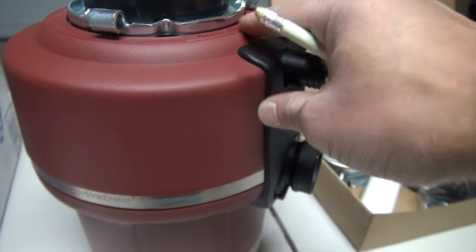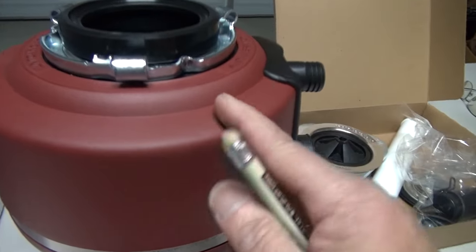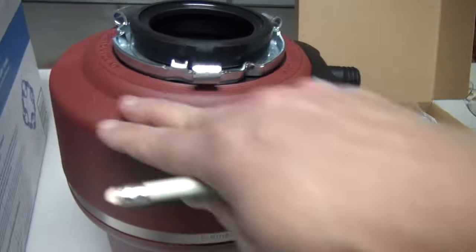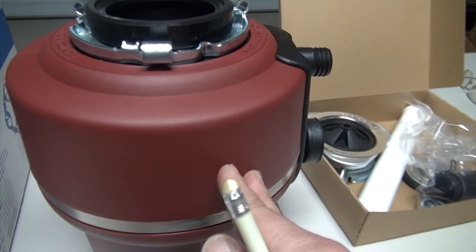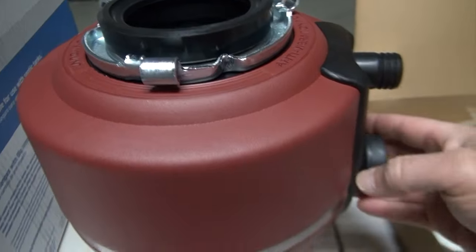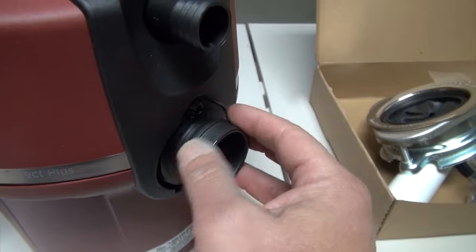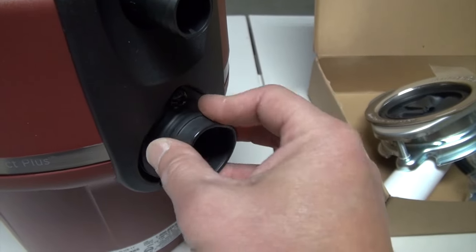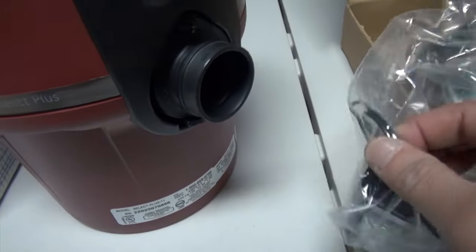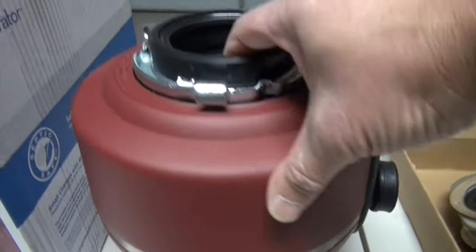This is also a quiet series. As you can see, this thing is humongous — bigger than a normal smaller disposal. That's because in the area where all the grinding is happening, underneath this plastic body, it's sound insulated. So when the grinding happens, most of the sound is kept within. The other piece that makes it quiet is this flexible tube here. Normally this is a hard piece and the pipe is connected there, but here you have a flexible tube. When you connect the arm to it and attach the clamp, when it vibrates it doesn't transfer all the noise. So this is part of that quiet technology.